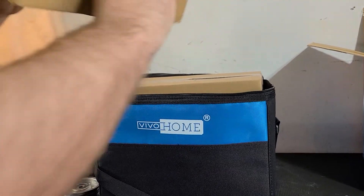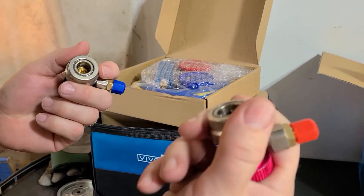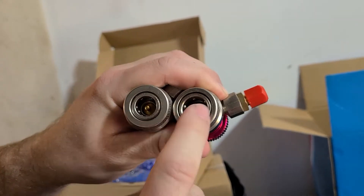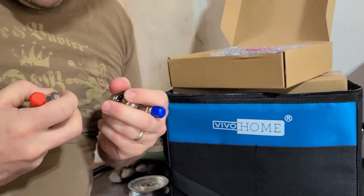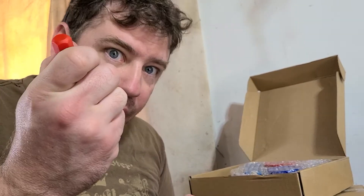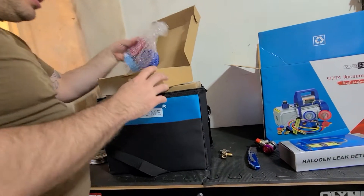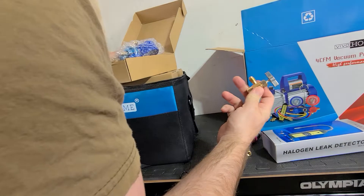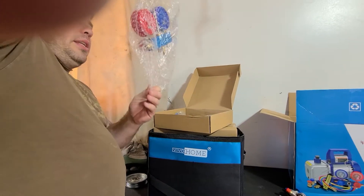Here's what you get — high side and low side fittings. You can kind of tell they're slightly different sizes. On mine, I kept trying to buy at the junkyard or at the parts store, and all they were selling was the high side labeled as low side, so I had to go to the junkyard and get a bunch of them just in case. The valve in them goes bad, but it's not a schrader valve on these — it's different. We've also got brackets for hooking into the top of a can of R-134a, and a nice little gauge.